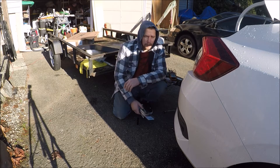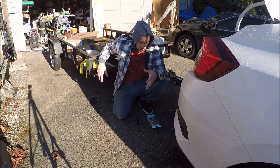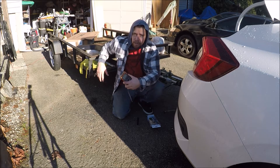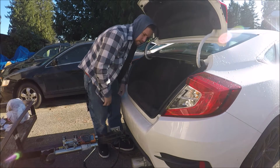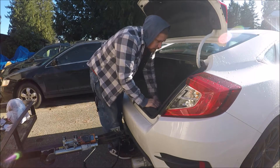The beginning of this video is going to be specific on how to access the wiring in a 10th generation Civic, but from there on you'll see how to test the wiring, figure out what you need to tap into, and how to wire it up. So let's get started. The first step to make it easy is to get rid of this spare tire carpet cover — you could probably work around it but it's pretty simple to get out of the way.